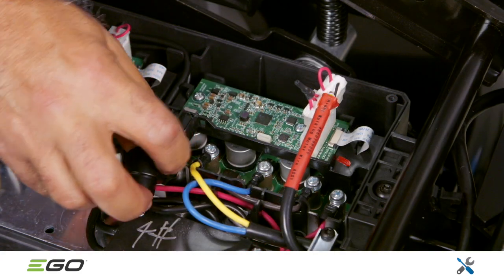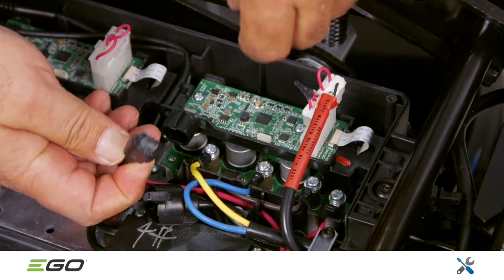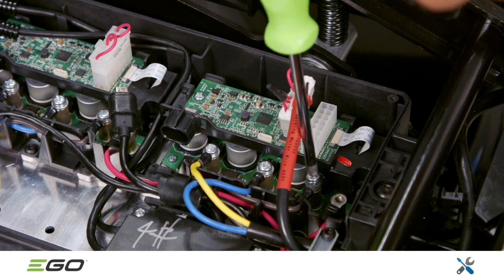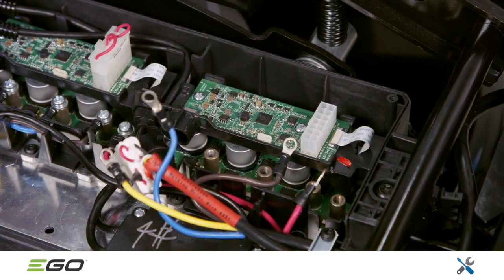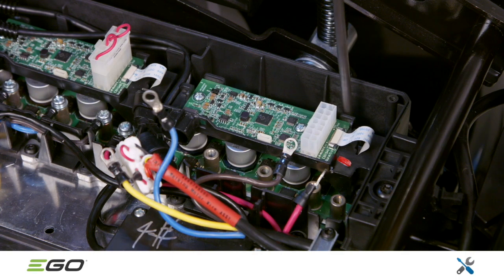With the 14-pin connector removed, disconnect the Type-C plug, which is secured by a wire holder. The rubber cover on the plug should be set aside and reused. Next, disconnect the 4 colored wires and pull them from the grooves to clearly expose the 5 screws that secure the PCBA to the control box.